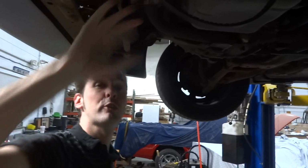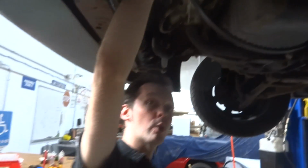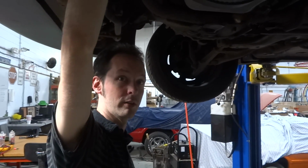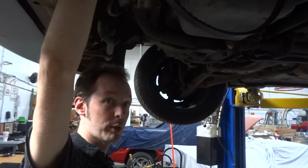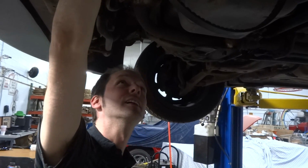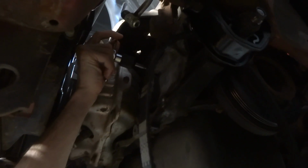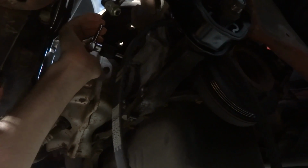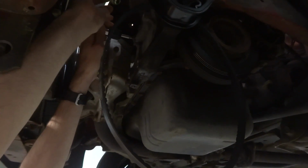Right. Nice and with just fingertip pressure. If it takes anything more than just the lightest of fingertip pressure, either you're doing it wrong or there's something bad happening in the hole. Because we're just chasing existing threads. With new threads, it's a little bit more pressure. But tapping is knacky. There's a touch to it. It's easy to do, but it's easy to do wrong. Oh, thank God that moves. Okay.